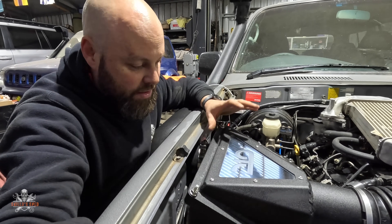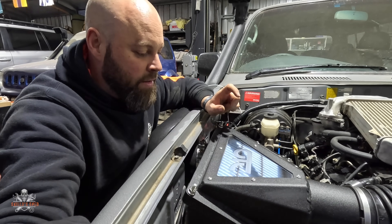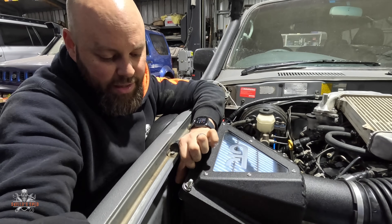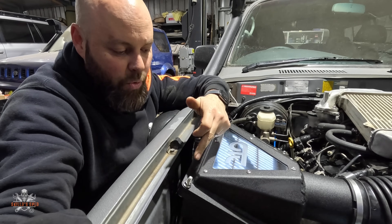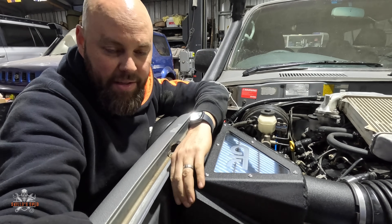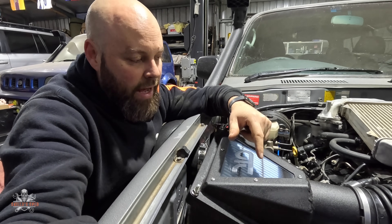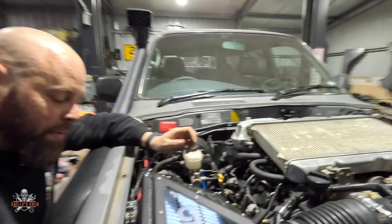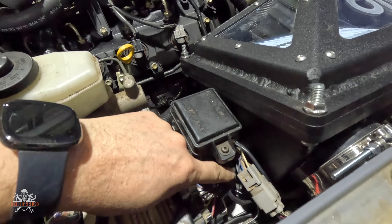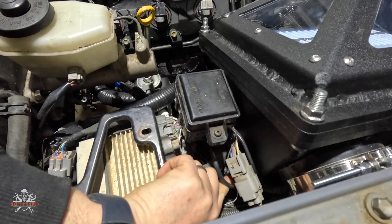It's a design that runs the 79 series air filter, so I can just buy an air filter off the shelf. There are three pieces that wedge together and all the sealing is around the factory seal, so I don't have to worry about this sealing as much because all the factory seal is already there. It just goes into the intake. Down in there I've also got a little airline fitting that I can fit up to.